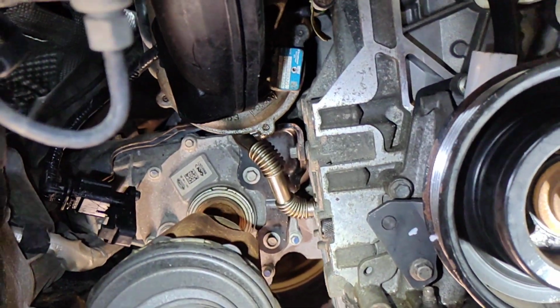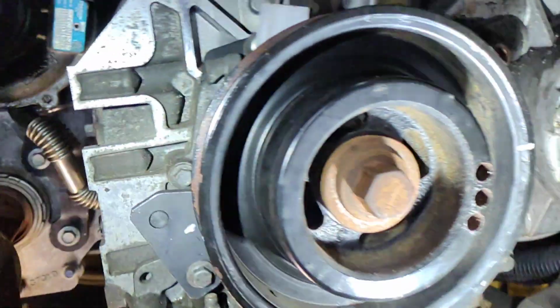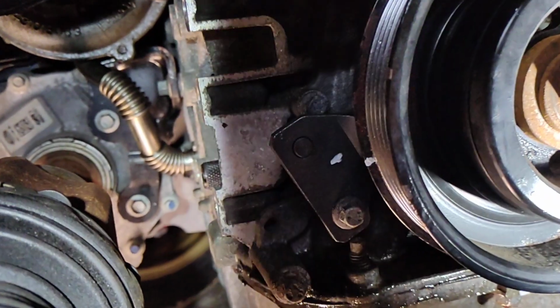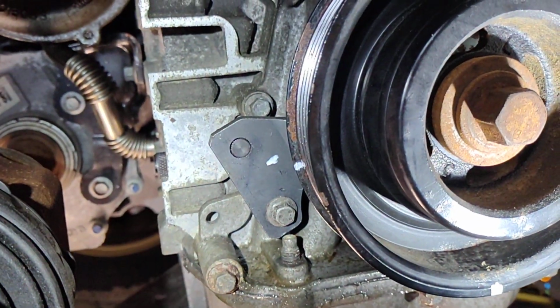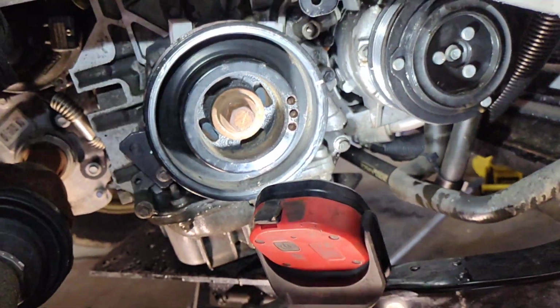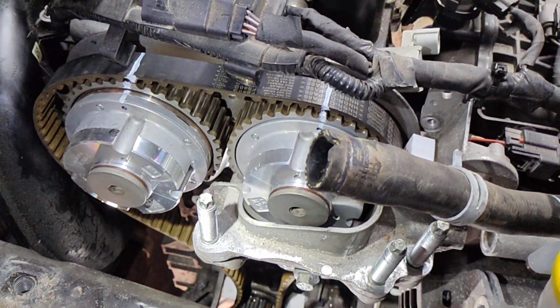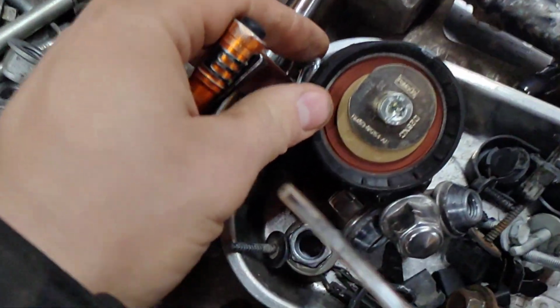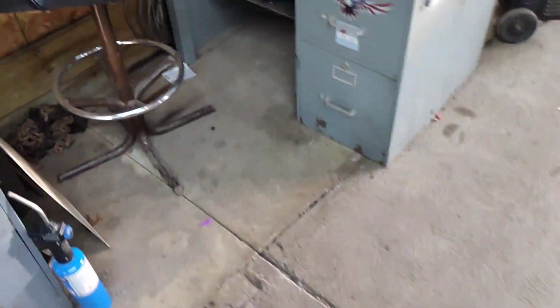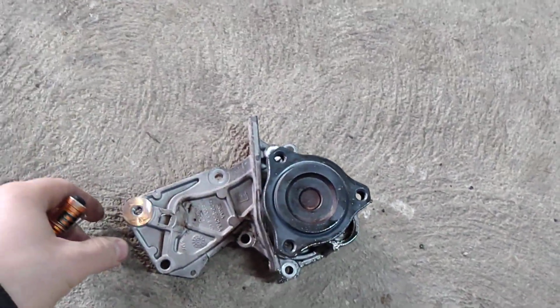The CV axle support bearing to put the timing plug in, because they don't have keyways on the crankshaft, because those are lame. The locking tang for the harmonic balancer, crankshaft pulley. It's not really a balancer, I don't know. The 3D printed tools you gotta buy to make sure the thing doesn't move, because what better place to bolt this timing belt tensioner than the actual water pump itself? Because remember, oh man, it's broken now.